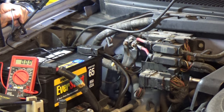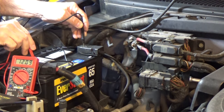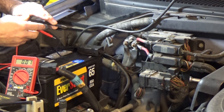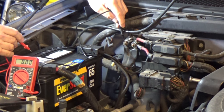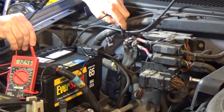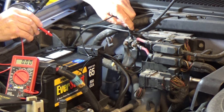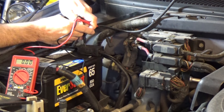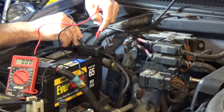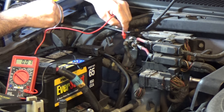Before we get started with the repair, I like to check the voltages — make sure everything's good. In this case I know it is; I'm just showing you guys. You've got a little volt meter. This one has 12.5 volts right now on this battery. Go from the terminal on the left side — that would be ground — over here to positive. You should have voltage, and I do: 12.5. Then swap: go to the right side terminal and go to your negative. Go from your negative to your positive side, and we have voltage there. So we know there's voltage to that solenoid.